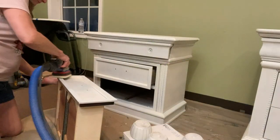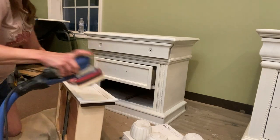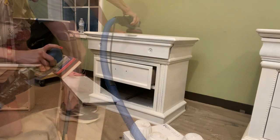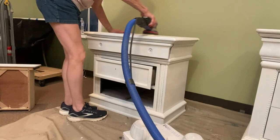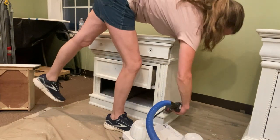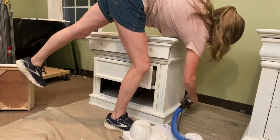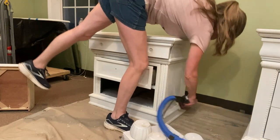The primer is dry and feels a little rough, like light sandpaper — that's normal. I'm going to be using a 220 grit foam abrasive pad to lightly and very quickly sand it smooth. You want your primer coat to be smooth because if it isn't, when you apply paint, the paint won't look smooth either.